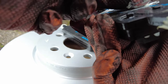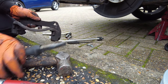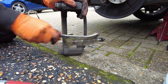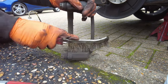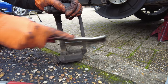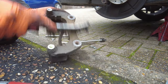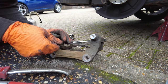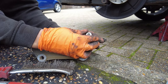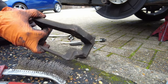Put that on the outside as well. Next, take the old fittings and clean them with your brush so you can ensure the pads are sitting correctly on the caliper holder. Now, this is very important — you have to check that these slider pins are moving freely and not seized. As you can see right there, there's no problem with them at all.